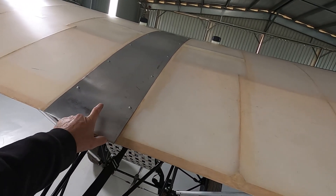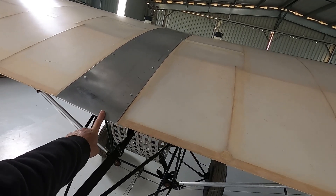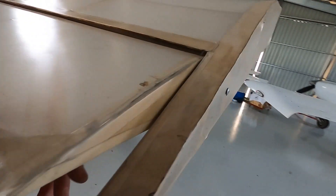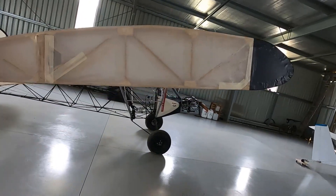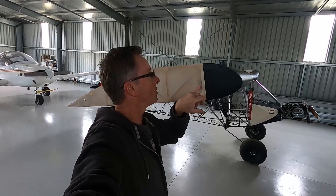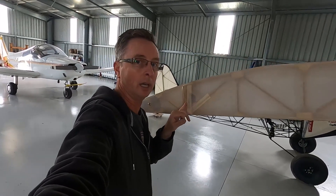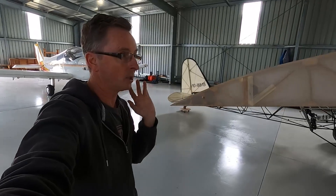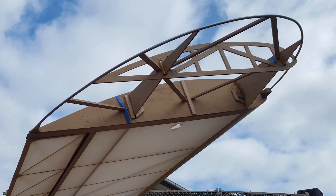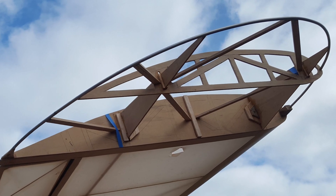The gap cover I would keep — I think removing it would affect the aerodynamics too much and it's part of the plans anyway. Moving along: I've got two mounting blocks on each wingtip — one on the inside and one on the outside — which were for the Piper Cub style wingtips I made but never finished. Those could potentially be removed for a small weight saving.